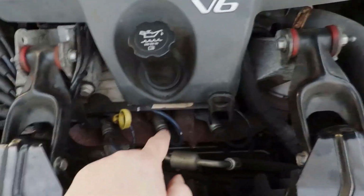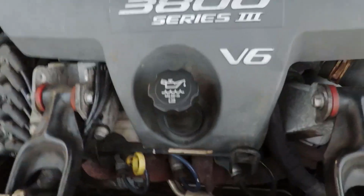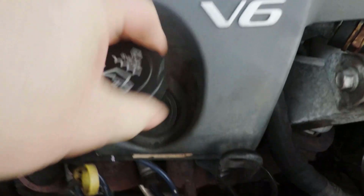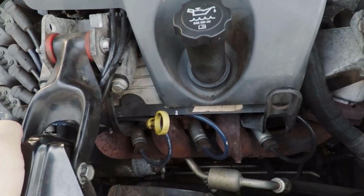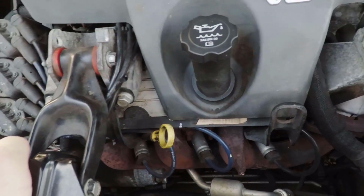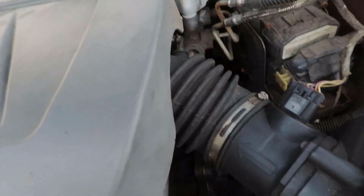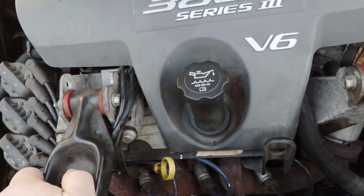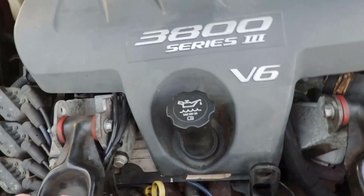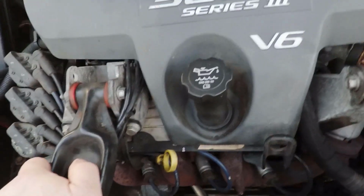Now, once you've done that, what you're going to look for is for it to leak down, and you're going to try to listen for where it leaks to. If you hear it coming out of here, for example in the oil, that would indicate possibly a blown head gasket, or most likely bad rings, a cracked piston, or something on the bottom end that's messed up. If you hear it leaking through the intake manifold, coming out the throttle body, that would be an indication you have a bent or damaged intake valve, or an intake valve that's not closing fully. The same way, if you hear it leaking out the exhaust, that would tell you the exhaust valve is the problem. So that's basically what you're going to do there.